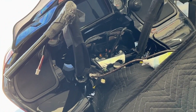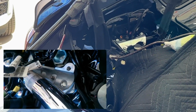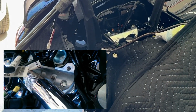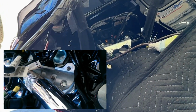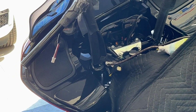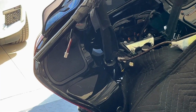So there is a pin. Here's something you should know. Underneath the handlebars, in the bottom clamp, you'll see a pin sticking up. And it's just off to the center. I've seen many times either people hammer them down or pull them out, because the aftermarket handlebars don't always have a hole like the Harley bar does for that pin. And it's just a pin to keep the handlebar from swinging forward or back too far.